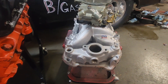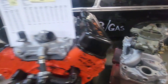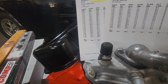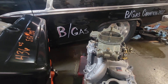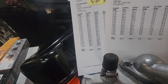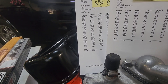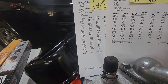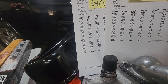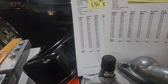The horsepower it made was 556 horsepower and 550 foot-pounds of torque. That was with the Edelbrock RPM Air Gap intake — the same intake as the previous 408 test. The carburetor I used on the 436 was my Pro Systems 1000. I used a regular 750 on the bored-out 396, and the Pro Systems on the bigger motor. In my testing with a cabinet of 12 carburetors, if the motor makes over 500 up to 700 horse, there's not a carburetor I own that makes more horsepower than my 1000 CFM Pro Systems.